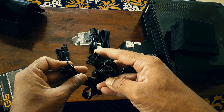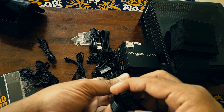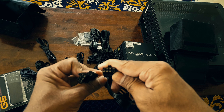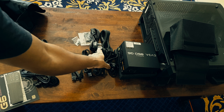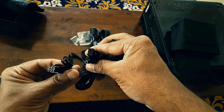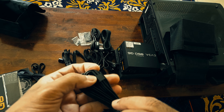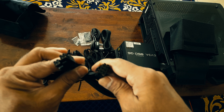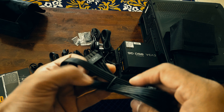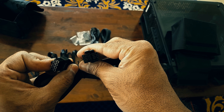This is the ponytail VGA cable with an 8-pin connection on each end. This one is the non-ponytail one. The end which has two pins separated goes on the GPU side; the unsplit end goes on the PSU. For the CPU cable, the four pins separated from each other go on the motherboard — the unsplit end goes on the PSU. Two cables for CPU.